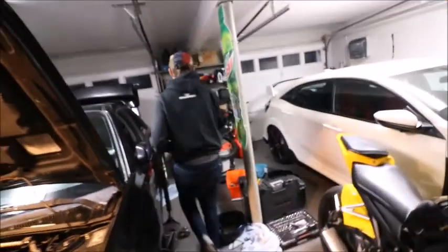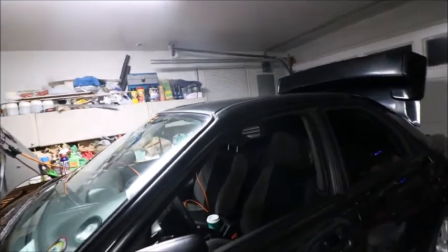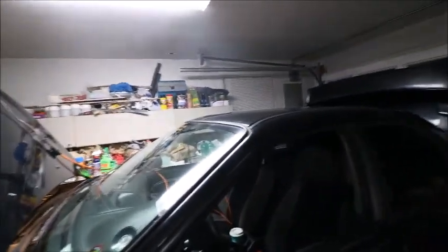That's coolant reacting to the oil. See that spot? That's the reaction with the oil. It's contaminated, much worse than before. There's a whole bunch of air bubbles getting trapped, a lot of air bubbles in here and a couple of mill shavings. So yeah, the new oil definitely flushed out the old one. It seemed like it flushed it out, but it wasn't enough, definitely knowing that it does have head gasket failure, for sure.